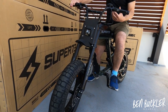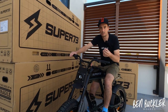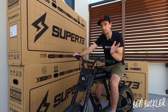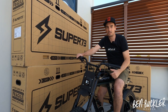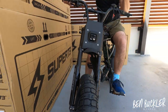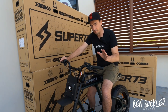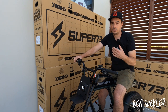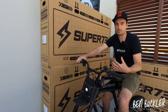New tires can be slippery — you need to wear them in. In the manufacturing process, new tires can have a little bit of oil on them. So as exciting as it is, don't go smashing around corners super fast because that front tire can slip away from you. Take it easy at the beginning and the tires get grippier over time. When riding around town, please set a good example — don't hit anybody, take your time. These are big bikes and you may get some looks.